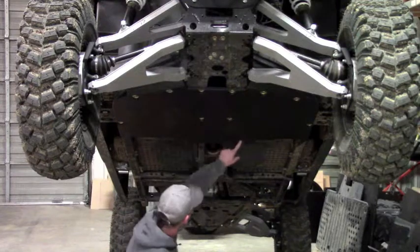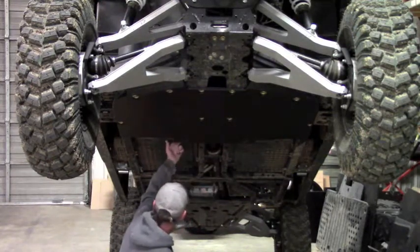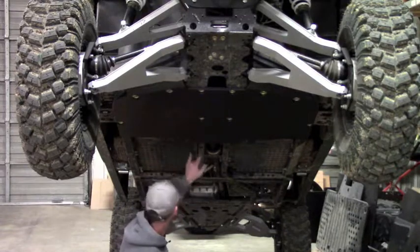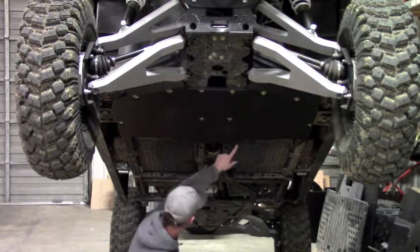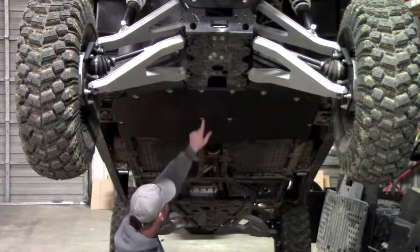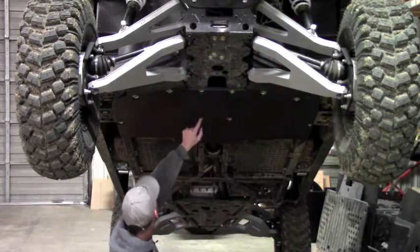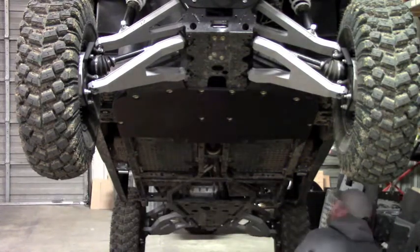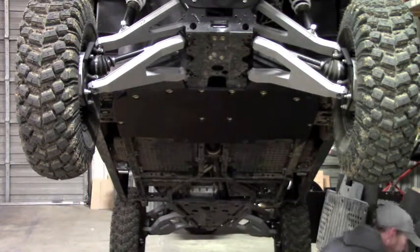I haven't started these 2 rear holes yet because those are going to be a common mount with the next plate. And these are going to be their longer 25mm bolt. Anywhere where it's the shallow counterbore is going to be a common mount with the next plate down the line, and it uses a different bolt, the longer bolt than these flange bolts that are being used on these other mounts here. So now we're actually ready to install the next plate down the line.